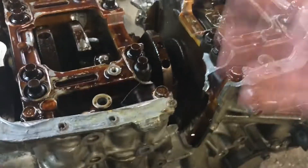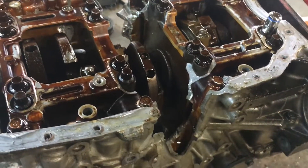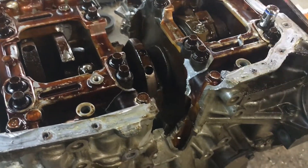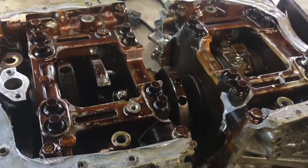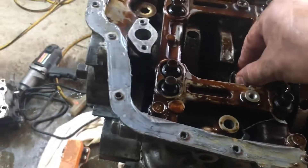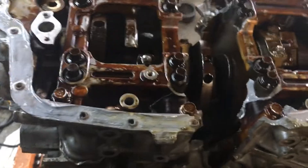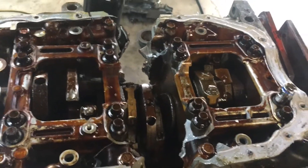These look okay. What happened was when the rods broke, they broke on the compression stroke or probably the exhaust stroke, and the piston kept traveling upward in the bore and smacked the valves, which is quite violent. I think we may have broken number one too but I can't see — we have to get the girdle out of the way.